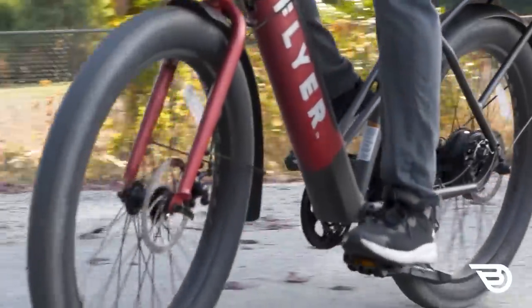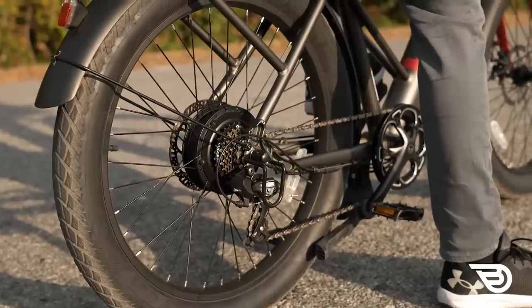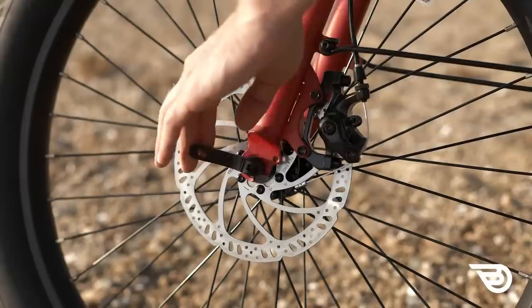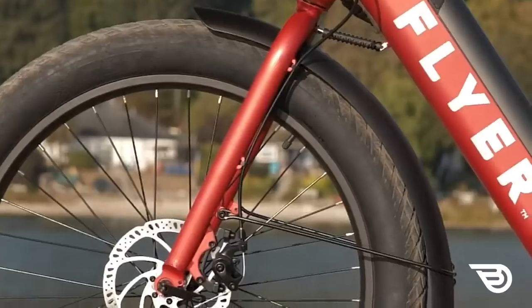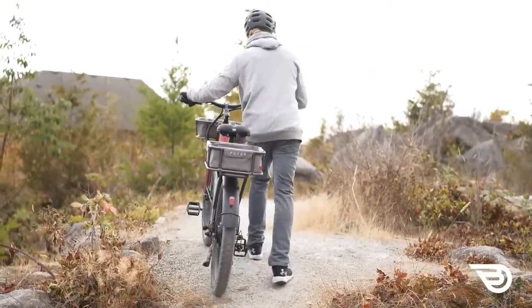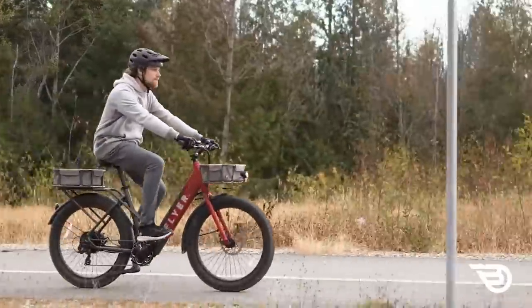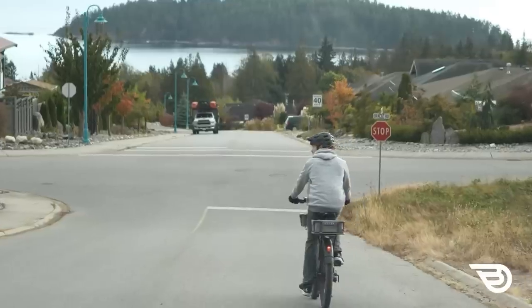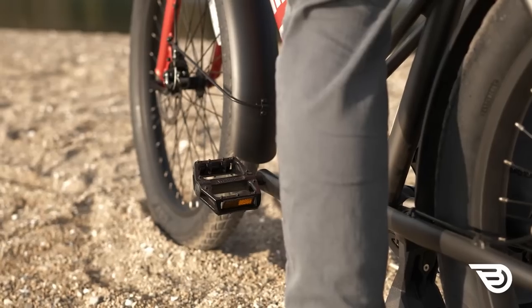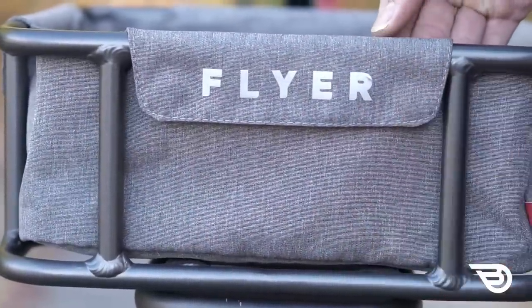The tires are large and offer a comfortable ride on the road — cornering is decent and the ride is comfortable at speed. The CST Big Boat 3-inch tires offer good cushioning, and the included puncture protection is a nice touch. The wheels are 36-spoke steel rims and appear very robust. The 26-inch tires feature a quick-release front axle and bolt-on rear axle. The hard plastic fenders with metal hangers fit snugly and perform well under most conditions. Safety features include a rear brake light, front and rear illuminated lights, and reflectors on the pedals and wheels. The Flyer logo on the baskets is made from reflective fabric, and an integrated bell is located on the left brake lever.